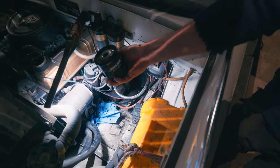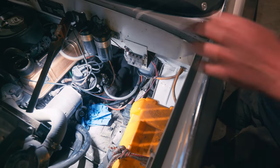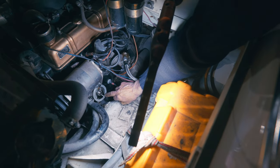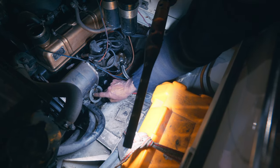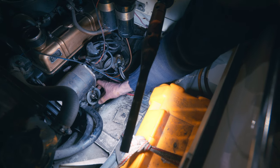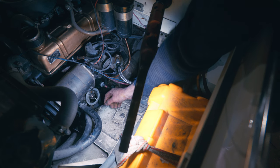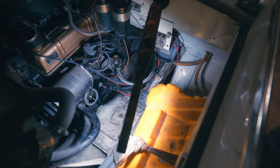So that's our little oil filter - the little Borg and Beck on there. So we'll catch as much oil as we can and then we'll put a new one on. Here we can see we've got this oil filter sandwich - these are takeoffs to the oil cooler. This is effectively a sandwich plate that bolts on, and then you can have a spin-on modern style oil filter on it. Originally these would have had a big oil canister with a paper element in it, but this has had this conversion done, partly because it's got the oil cooler on it.